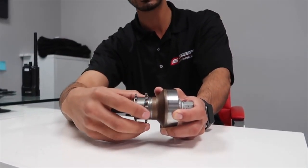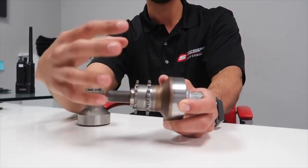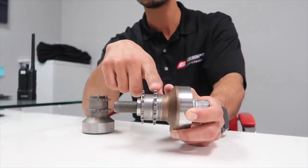If this happens to spin out of sync because all that torque hit all of a sudden at once and the tangential force exceeded the breakaway point of the static friction, it's going to be completely out of sync from the crankshaft, which is the whole reason why you never want this spinning. Does that make sense?